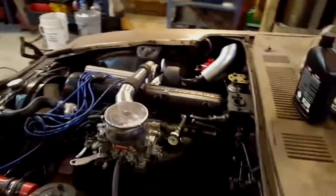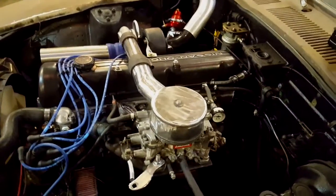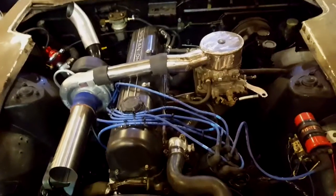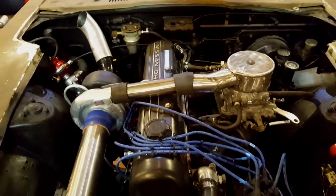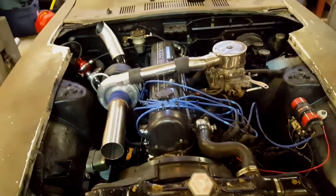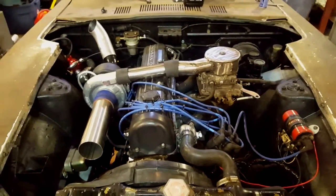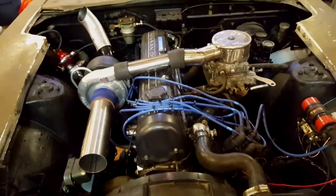So that's pretty much it — it runs good and the engine sounds really good. There's no valve noise or anything, which is pretty awesome. I'll update you guys with more videos once we get boost actually going through it. I still have to hook up a pyrometer, a wideband, and a boost gauge so we can see what's going on. I don't think I'll have a lean problem with that carburetor because it's massive for this engine — we're over-fueling it right now, which is okay for now.